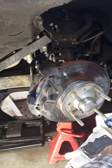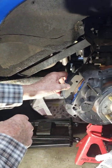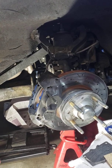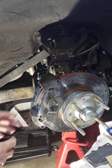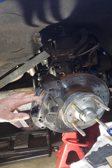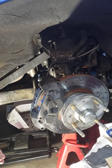It's also a good idea to scuff up your new pads a little bit with sandpaper. And the break-in process is very specific for racing pads — you want to make sure you follow the instructions on the paper in the box. Otherwise, you'll have bad results and they'll glaze over. These are expensive pads, around $200 to $205 for the full set. You want to break them in very, very properly.